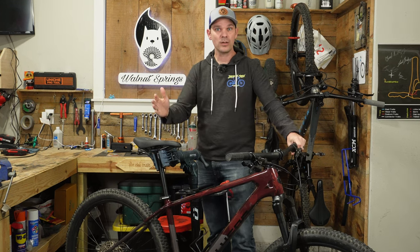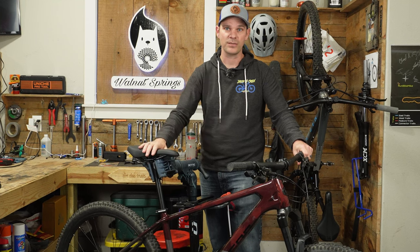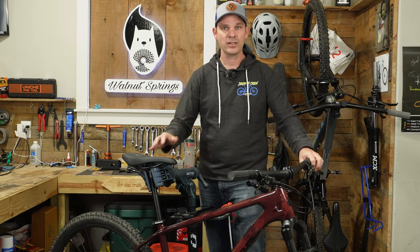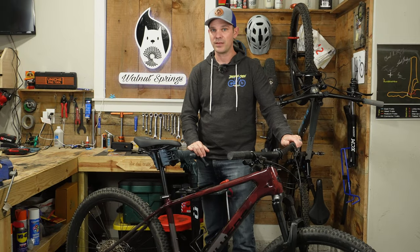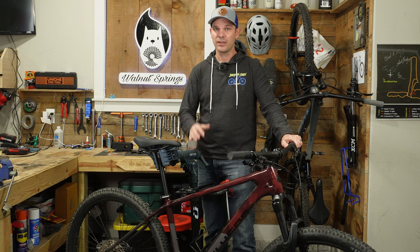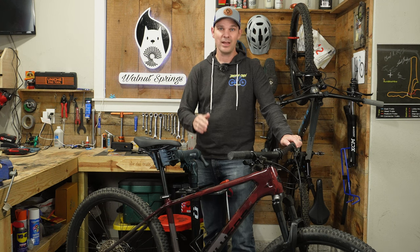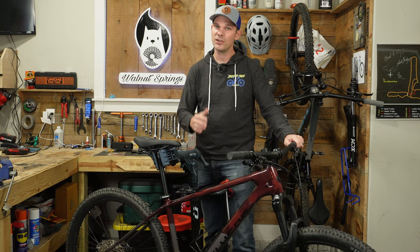With this XC style bike, I found I really had to make sure everything was dialed in perfectly. I had to focus on seat post height and the position of the seat. I also lowered the stem by about 15 to 20 millimeters to give it a more aggressive feel, and turned the bars in a little bit more to give some back sweep. After making all these changes, the bike started to feel more responsive and a lot more nimble. The carbon is very stiff, which translates to both a good thing and a bad thing. The good thing is every pedal stroke gives you instant power to the back wheel. However, with that stiffer frame, it does make it a little more jarring — so if you're expecting a supple ride, you might want to think again.